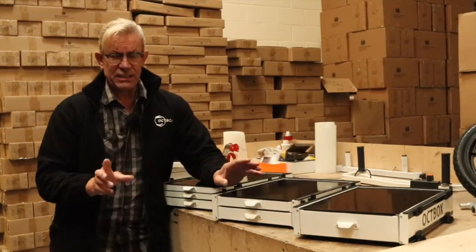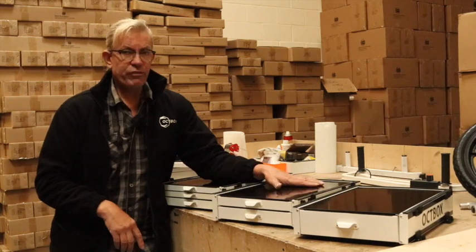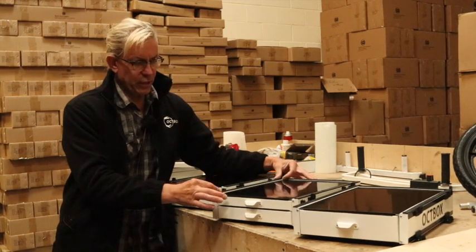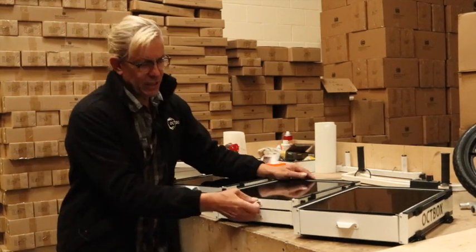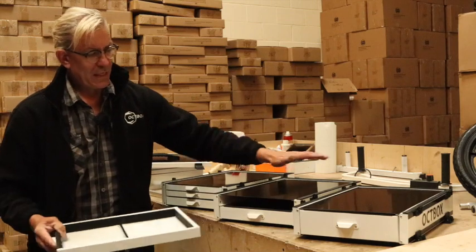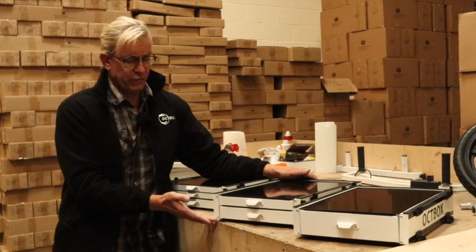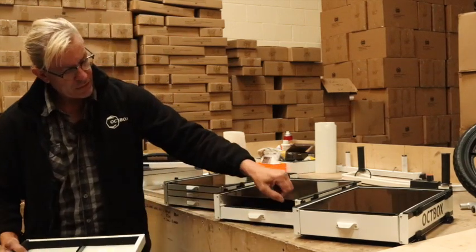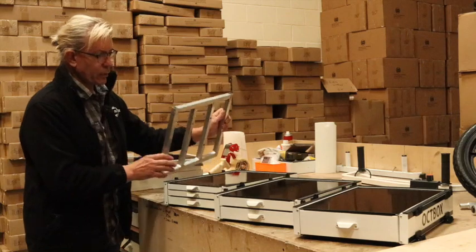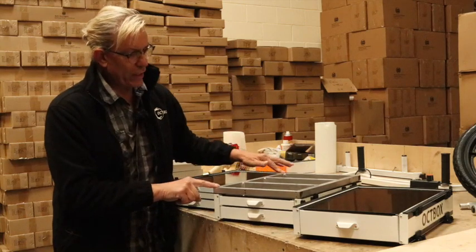Before I go on to the drawers in detail — I'll even show you how I lay my drawers out — I just want to go into a bit of construction. One of the questions people often ask me is, can I fit anything under the seat? The reason why there's no depth here, as you were probably accustomed to on other systems, is because on other systems there's normally a support bar that is part of the construction of the module itself. Whereas here, as you can see, the top of the drawer is literally just millimetres — this is very soft, pliable aluminium. The reason we can do that is because the seats fitting on top transfer all of the weight to the corners.